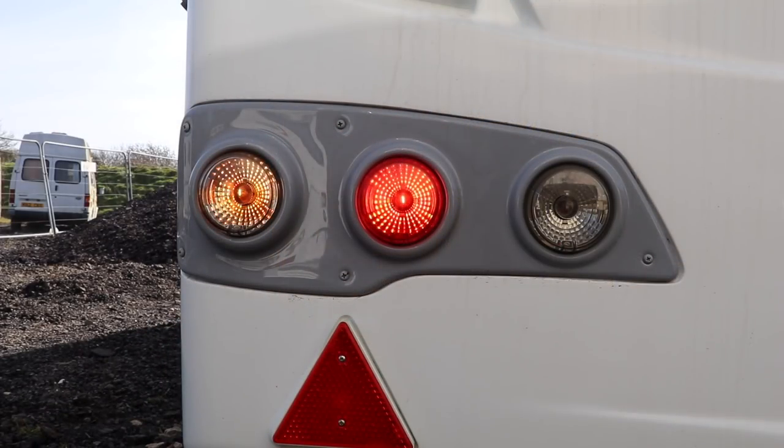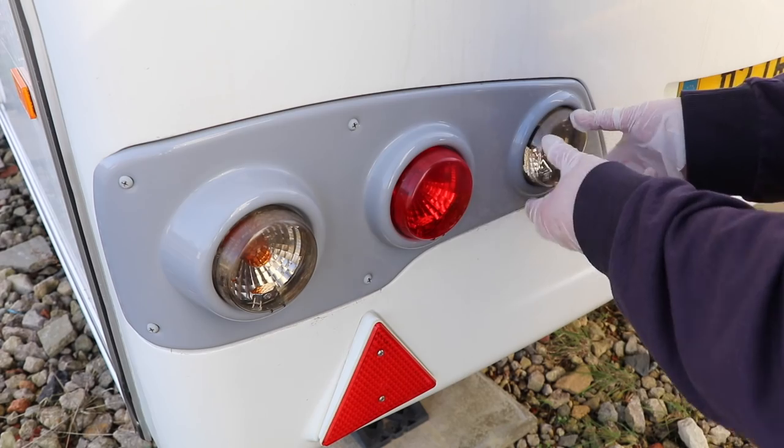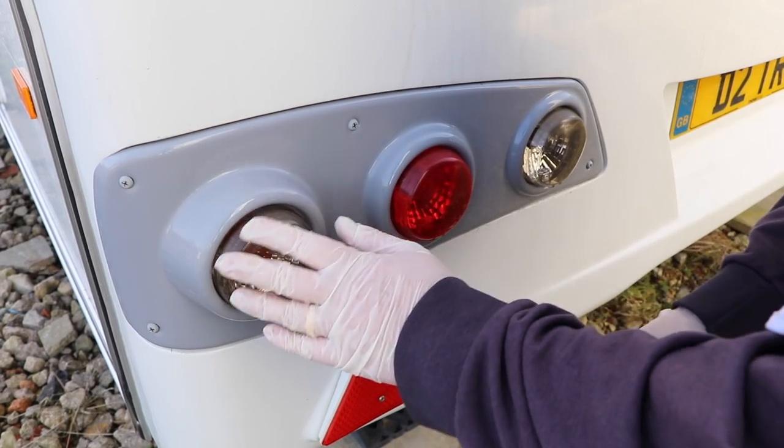Switch all the lights on, start with the hazards and go to the back of the van to make sure everything is working. Check the marker lights, the indicator lights, and all lights at the back — give each one a tap and make sure all lenses are in good order. Watch out for the effect where turning the indicators on also causes the brake lights to pulsate — nine times out of ten that means there's a bad earth connection from the plug at the front of the caravan and it will need attention. If there's still a problem after brightening up the plug with switch cleaner, get an auto electrician out — it could also be a fault in the car itself.